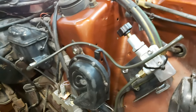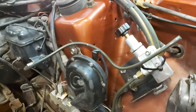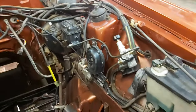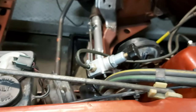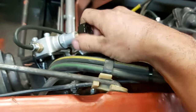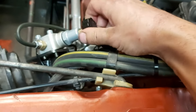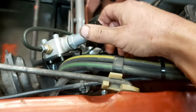I'll make a second part to this video to show how we can adjust this on the fly once everything is going. As you can see, easy access to the proportioning valve. All the way in gives equal pressure to front and rear systems, and all the way out gives 57% less pressure to the rear compared to the front.